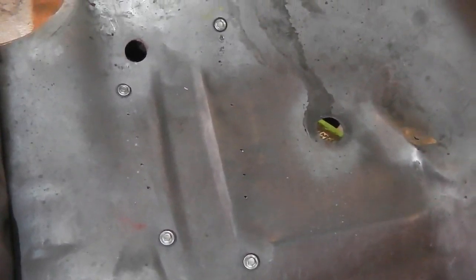as a spot weld removal, but it's actually the reverse. So that's how that system works when you haven't got your plug weld holes already in, like up here where we've took it out. They're already all in position, but the new floor pan, we need to know exactly where it went, and that chassis leg marks the spot for us. So it's now time to get the spot weld drill bit and lock and load and get them out.